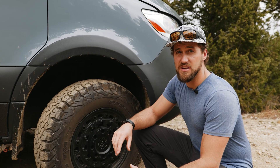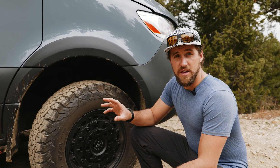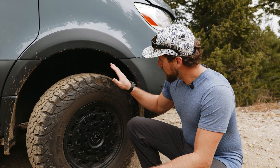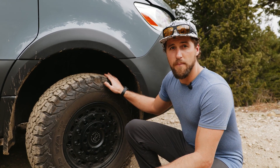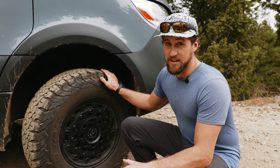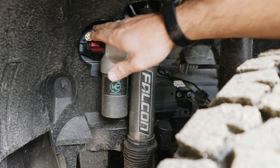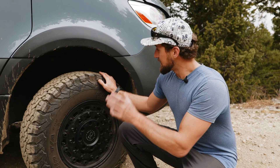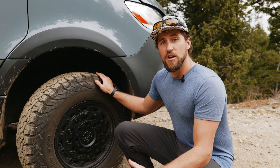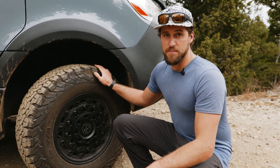Getting the right suspension is also critical. We want to make sure the suspension is right for the weight of the vehicle, since these build-outs can add significant weight especially with lots of gear. We have several different suspension upgrades to choose from, both from Agile Off-Road or Van Compass. This van has the Van Compass Stage 4.3. The Falcon shocks in both front and rear are adjustable, giving you dampening control as well as rebound control. It is an add-a-leaf in the back as opposed to a full leaf spring replacement like Agile, so there are pros and cons to both.